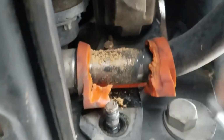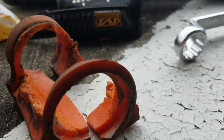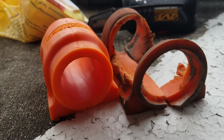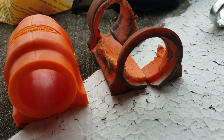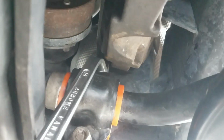As you can see, there's some mild wear on these old bushings. Put some silicone lubricant inside of the bushing where it will rub on the sway bar and then replace it. It's actually better to mate the bushing in the bracket and then approach the pair to the bolts. Push on the bracket and not on the sway bar, otherwise the bushing will pop out when you're trying to align it.